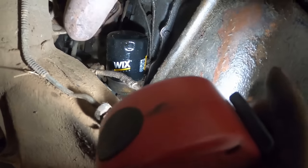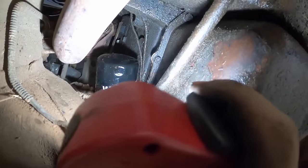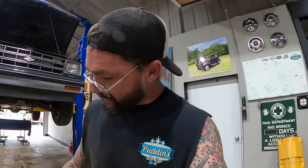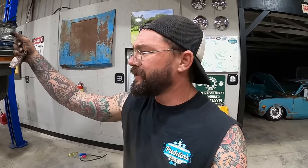Look underneath here. There's oil coming from way up there. Valve cover gasket as well. I can see it on the back side where it's actually leaking out. Gives us hope for our oil on the bottom side. I started looking because I noticed there's some on the oil filter. You can see where it's running down it, and then I think that's where our oil leak's coming from. That's making it down to the dust cover. That's what I'm hoping.